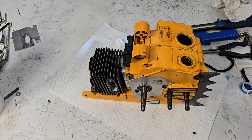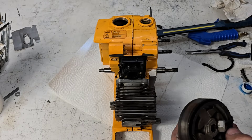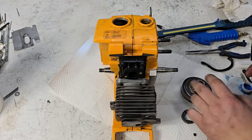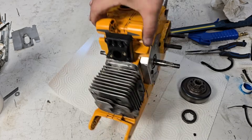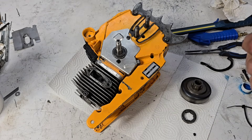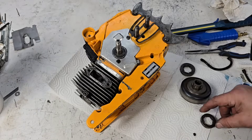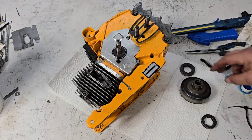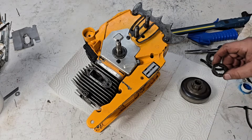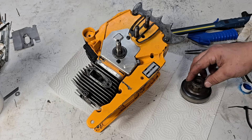Okay, so we have an oil system. Maybe we should put the clutch on. Here's the clutch — earlier I took it apart and put it all together with a zip tie because I knew it may be a while before we get this clutch back together. These are the coolest clutches I've seen. This is a three-eighth eight-pin, and we've got a seven-pin. I tend to be more of a seven-pin guy — let's put the seven-pin back on. We'll have enough chain speed with our port job; I don't think we're going to need more, but if we do we have one.